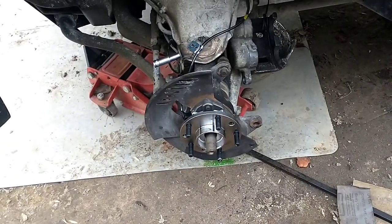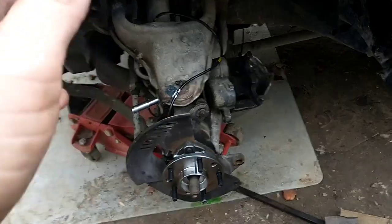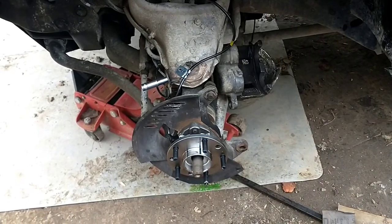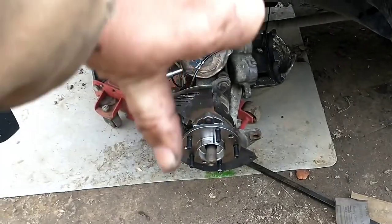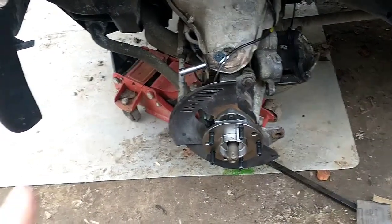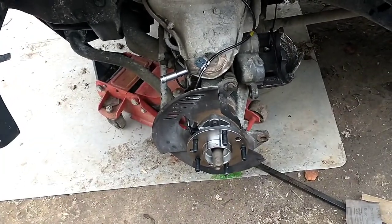Now the process is just reverse — go ahead and hook up your ABS speed sensor, then the rotor, brake caliper bracket, brake caliper, pads, tire, and wheel, and you're done. Thank you for watching and suffering through my mumbling and craziness. If you've enjoyed what you've seen, subscribe, thumbs up or thumbs down — whichever feels appropriate — and leave a comment with helpful tips or tell me how stupid I am. It all helps me out. Thanks again and see you next time.